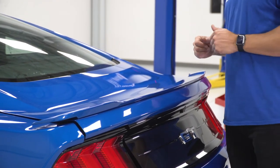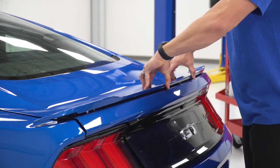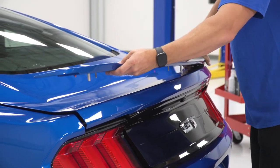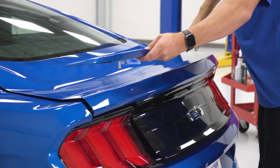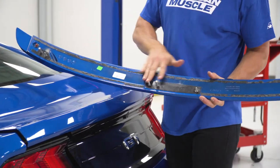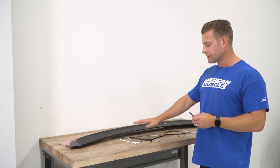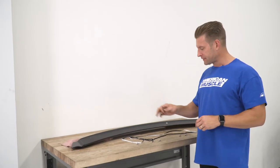With all of our tape released, it should be good enough to pull our factory blade spoiler off the factory trunk. Now that we have our factory spoiler removed and our brand new MMD carbon option on the table with a couple of microfiber towels underneath to protect it, there are a few steps we need to take before we can transfer it over. First, they include a couple of foam disks to be used underneath the hardware to protect the hardware from digging in too hard to the spoiler itself. They also include some foam weather stripping to prevent the spoiler from rattling on the deck lid. We'll install the foam disks first, then show you the weather stripping next.